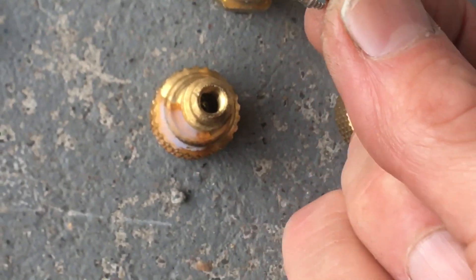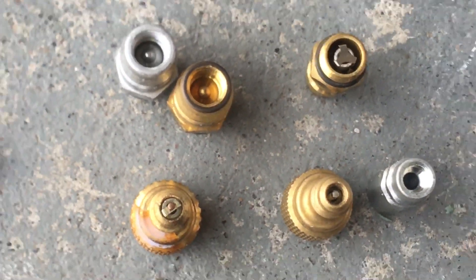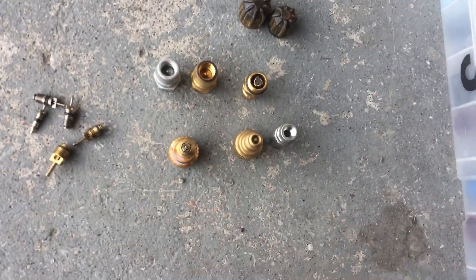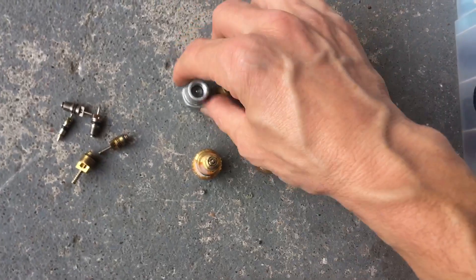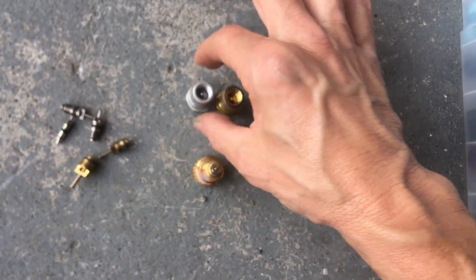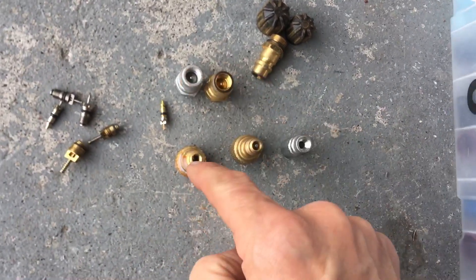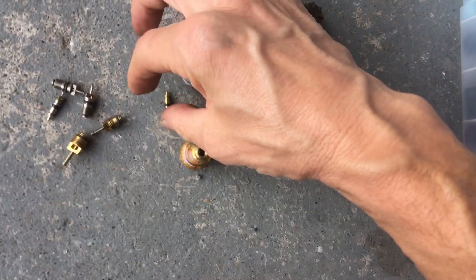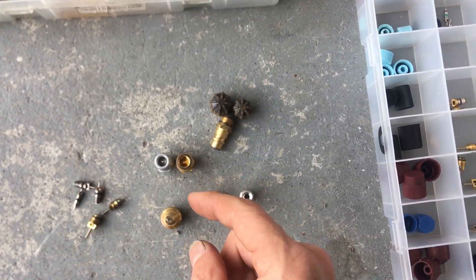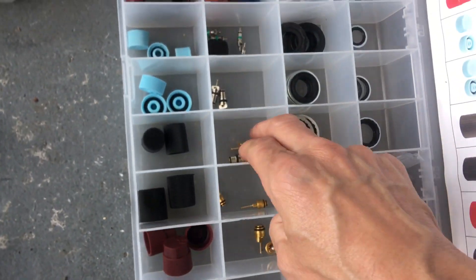Compared to this little guy — that's a little education for some of the HVAC guys saying, 'Why don't you put valve core removers on the cars?' Because the cars have something that is so large that with the cores installed it's still many times more flow rate than even with the core removed on one of the old R12 fittings. That's the difference between automotive and HVAC. Look at these monsters — these things are huge. Even the small ones on the low sides are huge.